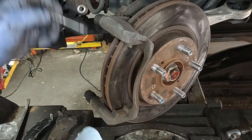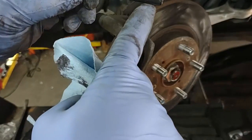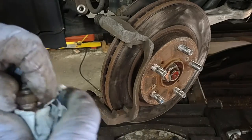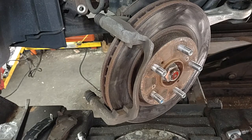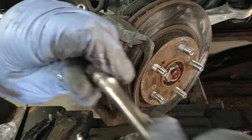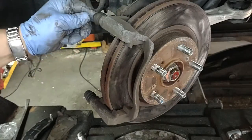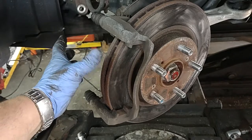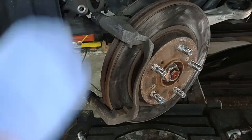In many cases, make sure you don't mix up the two pins. The top one goes in the top and the bottom one goes in the bottom, because the top one has a rubber on it — the bottom one doesn't have it. This is a Honda Odyssey 2008. Clean it a little bit, put some grease on it. You can see how easy it moves — I push it in and it goes back by itself. This is done.